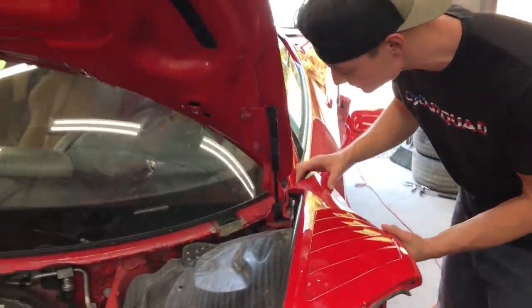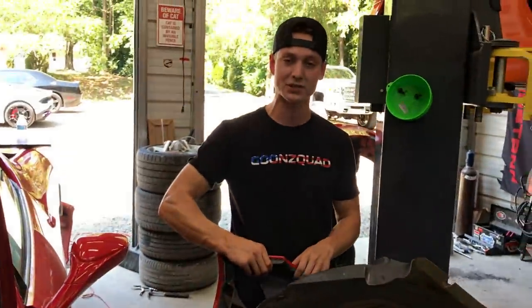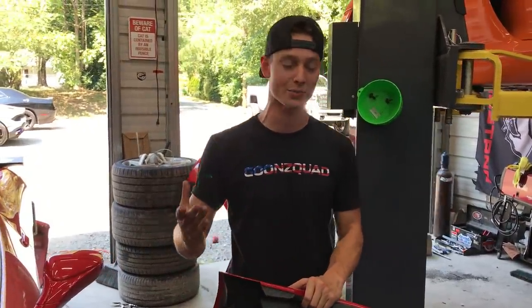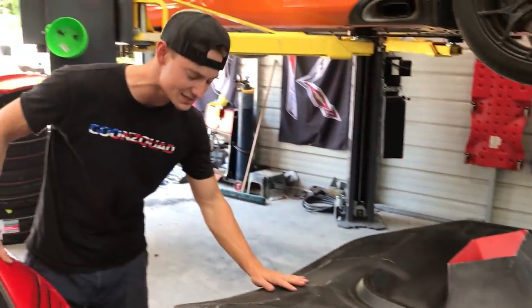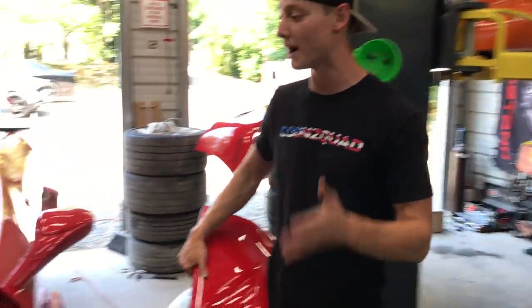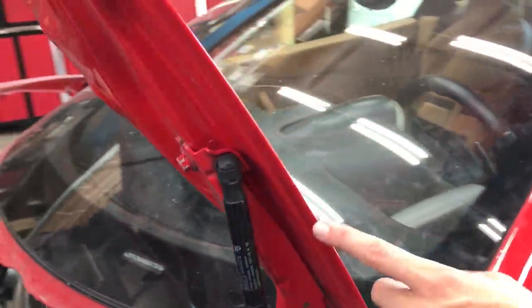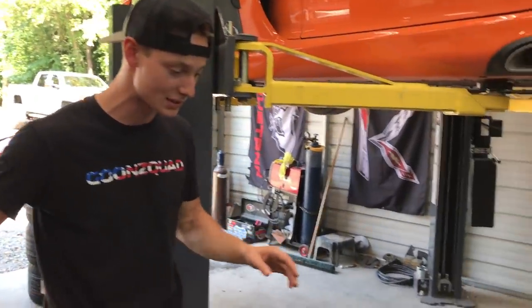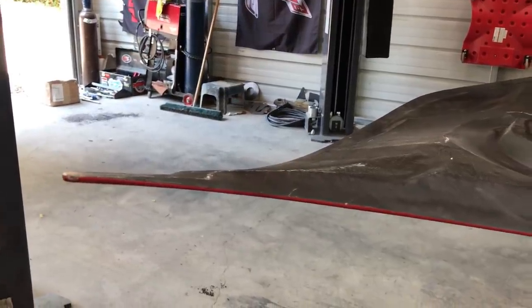First fender is almost there, but we are running into this hood hinge. As you can tell, we were thinking about trimming up this fender, removing some of this carbon, that way it could just slip right in there. But we actually brought in our GT3 hood. This sucker is quite expensive, it looks absolutely amazing, and we were thinking about how we should mount it up to the original hood hinges, but I don't think that'll be possible because, as you can tell, the hood is about an inch thick for that thread and that bolt to go into it. But this one is about a quarter inch thick, and there's just no way to put a thread in it. Yeah, that's way too thin.